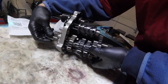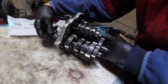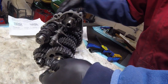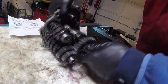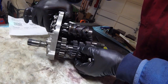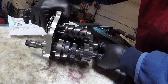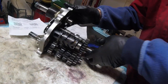So those are the sixth gear teeth of concern and I can definitely tell they're not the reverse tapered type — so that's the gearbox. A complex but fascinating piece of mechanical engineering. For anyone who takes their RG500 gearbox apart and finds gears similar to this, unfortunately the new upgraded gears seem to be very difficult to find. Hopefully you have the upgraded gearbox from the factory or had them upgraded as part of a recall or maintenance schedule.